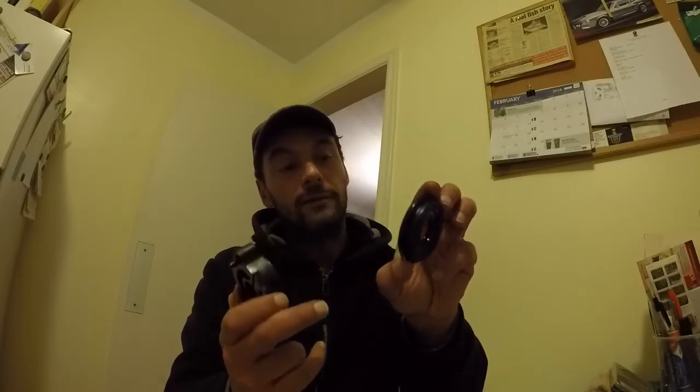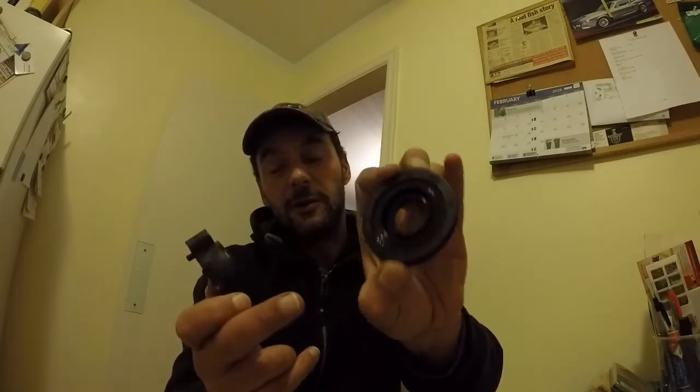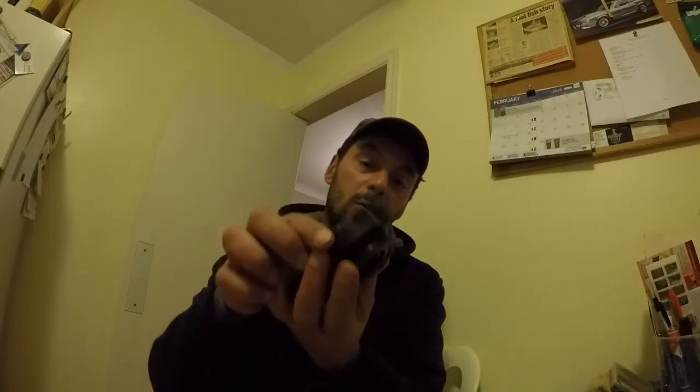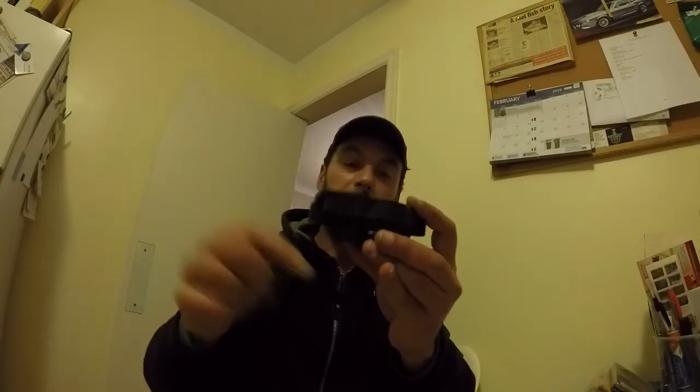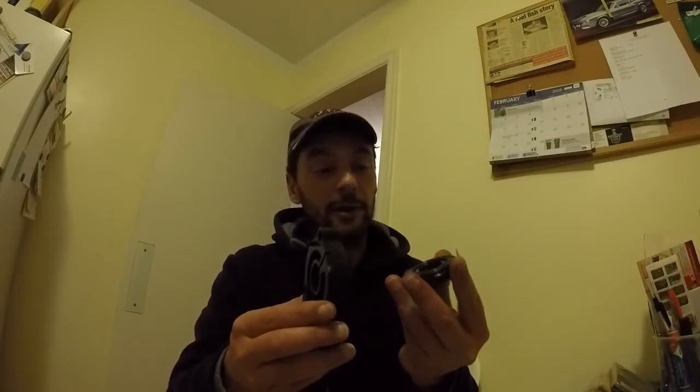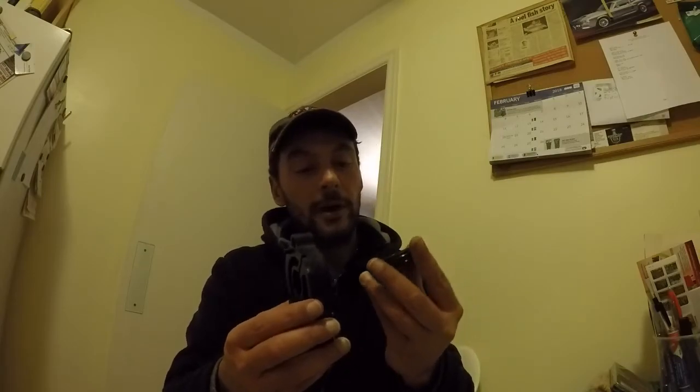And what I've learned is that the spring side on this particular unit, if they go together like this, will keep the oil in. This seal will keep the water out. So water, oil, not mixing very well, or shouldn't. So anyway, I'm going to marry some parts up.